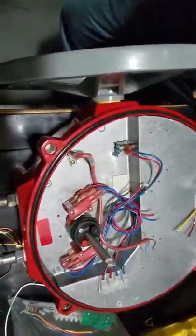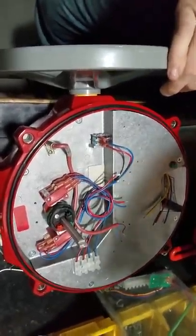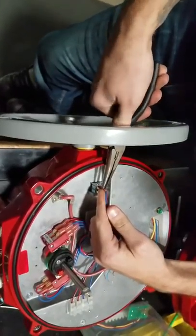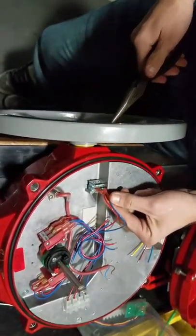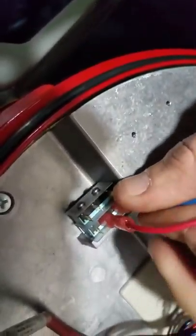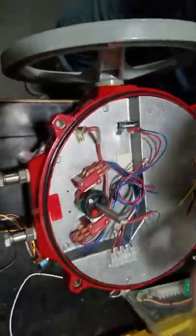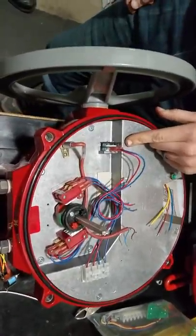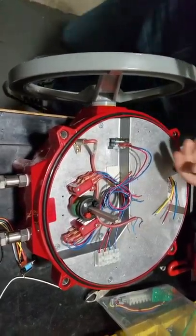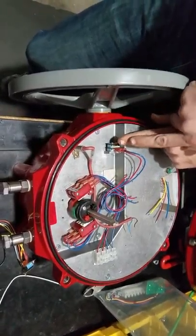First thing I try to do before I move on, so I don't forget, because usually you end up forgetting, is you're going to take this blue connector, pop it out, put it right below the red one. I can find the hole. Make sure that's in there all the way, good to go. Nine times out of 10, I will forget that, and I'll be like, why the hell isn't this working? Because you didn't move that wire. The whole thing won't cycle if you don't move it from, I guess, the 3 o'clock position to the 6 o'clock position.